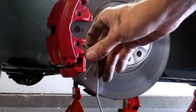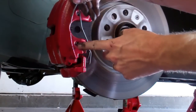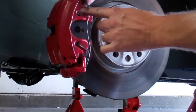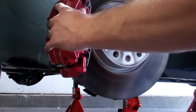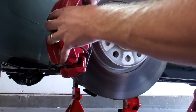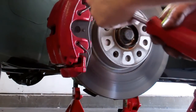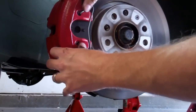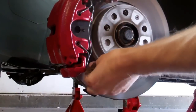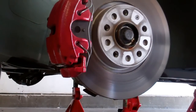The final piece I'm missing here is my wire snap. What I like to do is put it in the bottom hole first — you've got your holes here, put that in, pull it out, this is holding against the panel here, then push in the other hole. Then the hard part is getting this tab over — I'd usually use a screwdriver, but you can do it with your hand or pry it over just so it snaps over. Then you've got it solid. A little tap on both sides to make sure they're seated nicely in the holes — this is holding it tight. The caliper's a lot tighter now. That's the brake job done on the front.